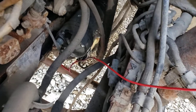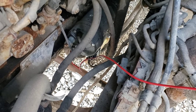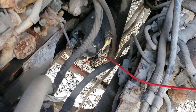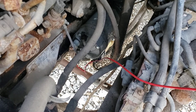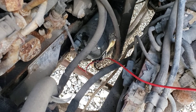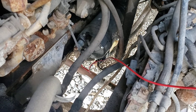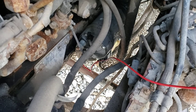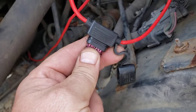That wire is going down there where the starter's at. I ordered a new solenoid down there, and that was replaced and took care of the problem. But this is the second time that solenoid shorted out, so this fuse here is really helpful to get in there.